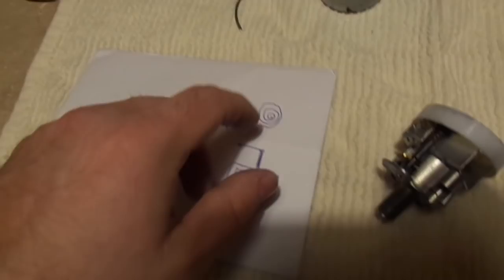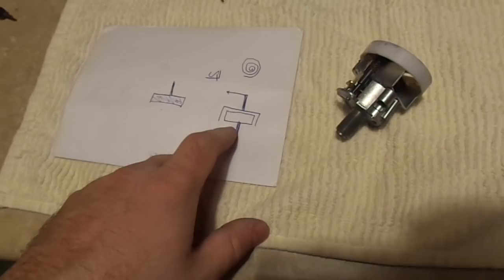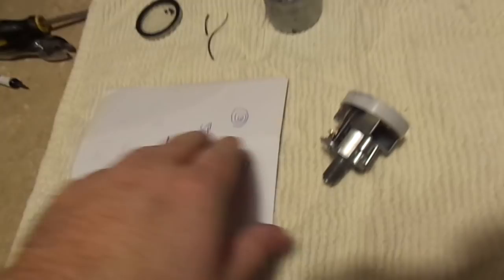That clock spring provides a counter-rotating force that can be overcome based on the speed of the drive shaft. In plain English: the faster the magnet spins, the higher the magnetic field created, which provides more torsion on that steel cup. The faster it spins, the more power it applies, and the more it can overcome the spring to reach an ever higher reading.